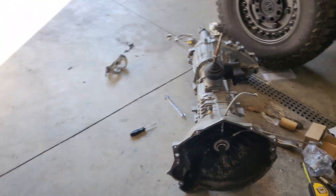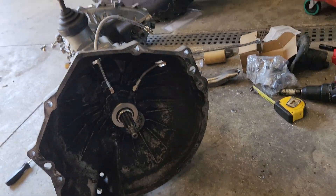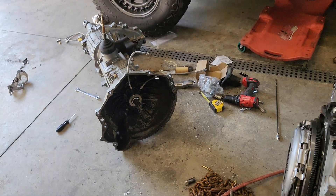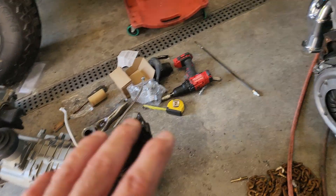So that's how I'm setting it up. I ordered two stainless steel flexible bleeder hose lines and made my own setup to route up to the clutch master cylinder. That will fix all your tolerance issues.